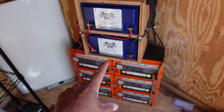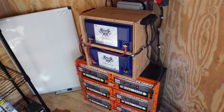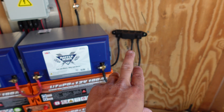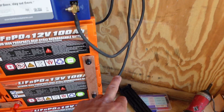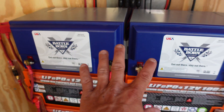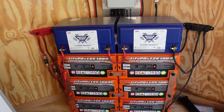I'm going to rip this box out and get these bus bars to the wall — it might look a little sloppy but I'm not changing any wires. All right, she's all done. I ripped them out and I think this looks a thousand times better now. I mounted the bus bar on the right side and the left side — positive and negative. I moved that cable as recommended. I'll neaten this up later. I used a shorter jumper between the two Battleborns since the copper-to-copper style wasn't going to work with these terminals.